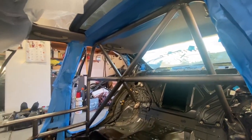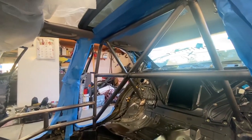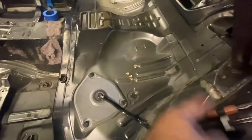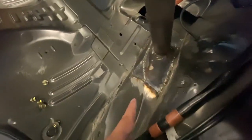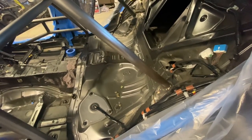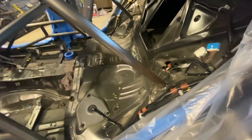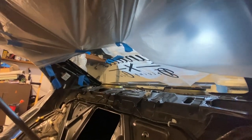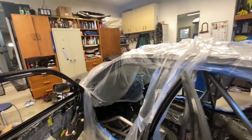I'm using a lot of masking tape and doing the best I can. I'm keeping some areas uncovered because there's metal exposed there and I have to paint it anyway. Once the masking is done, the painting can begin. The car is pretty much masked up. I got all the important parts: the pillars, headliner, most of the rear window. Got the door sill and especially the dash covered.